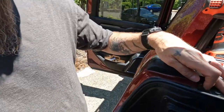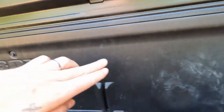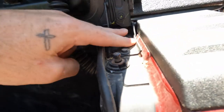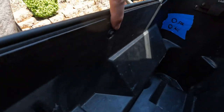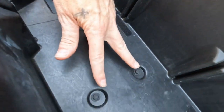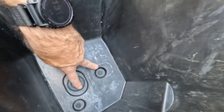We're going to start by removing the 10-millimeter screws found throughout the Ram box — two up here, all along the inside of the Ram box, two more up here, some along the inside, two on the hinge, one more here, then some 10-millimeter screws down here — two here, two more here, and two down in here.